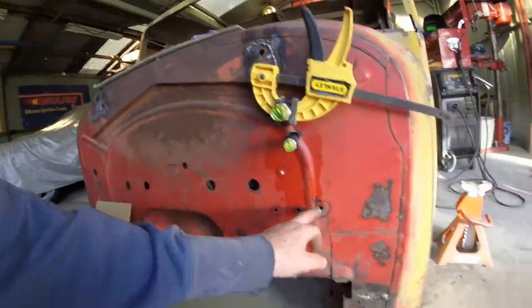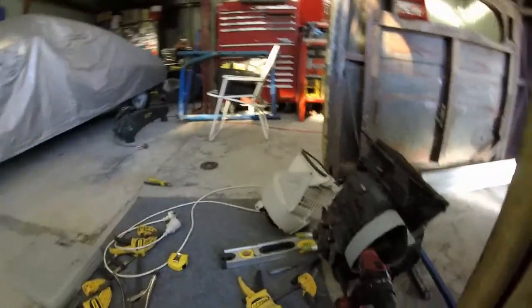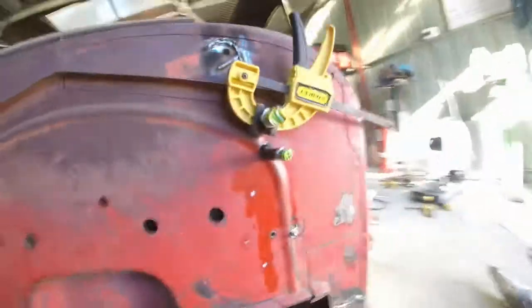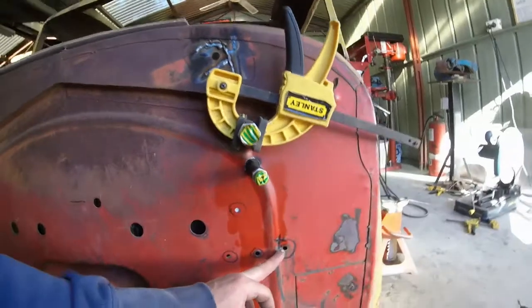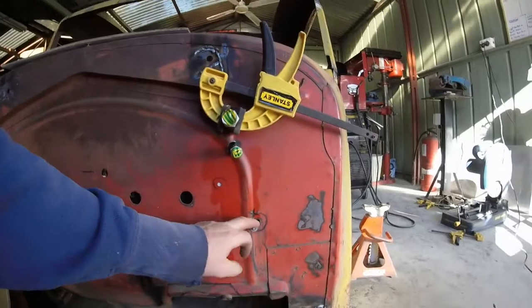From the outside I've passed that bolt through the hole that I drilled for that first unit — the white fan one — so they share the same bolt holes. That's got to be right because the tabs overlap each other and the bolt goes through the two of them. Then for the pipes, they're actually smaller than the nut, so I had to allow for the width of the nut. I used a one-inch, that'd be 25 mil, hole saw because I simply don't have a 25 mil drill.